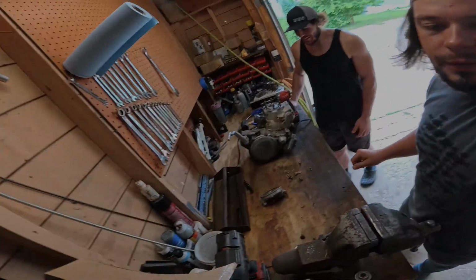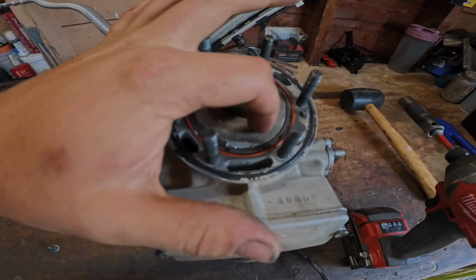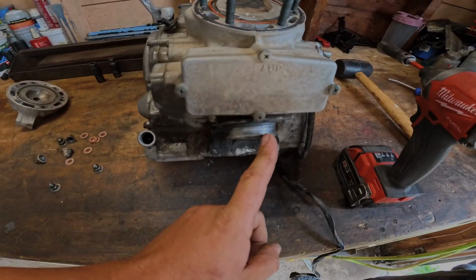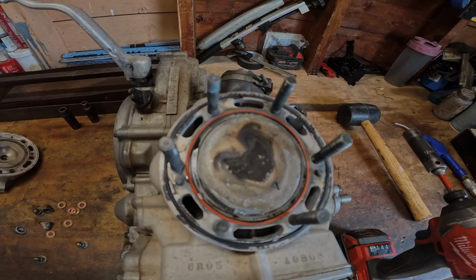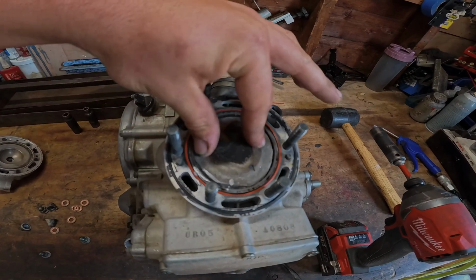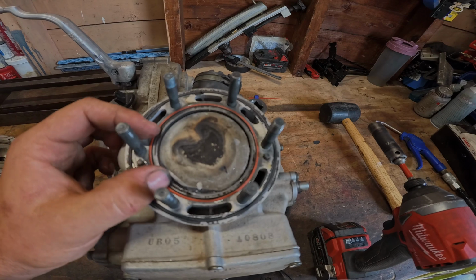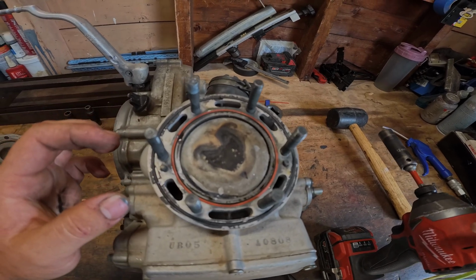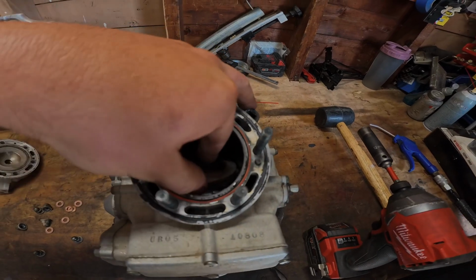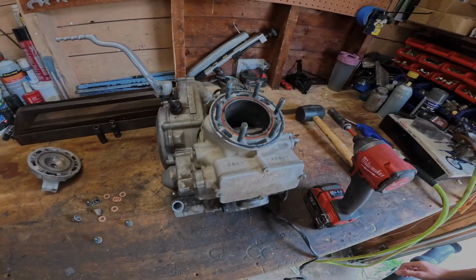Whoa. Okay. So what I'm talking about here is the arrow is supposed to face the exhaust port. That's not lined up anymore. So it's probably because the way it failed, or maybe a couple rotations. I'm pretty sure it broke at the wrist pin or whatever, and it probably just kept going up. Oh. Yeah. Oh, lordy. Alright, we're going to keep on ripping into this thing and try and get that piston out.